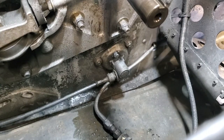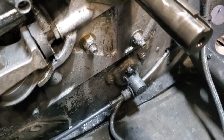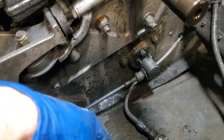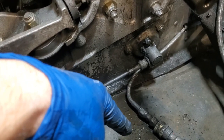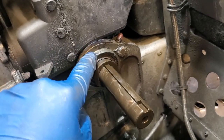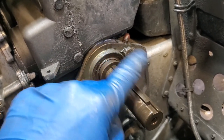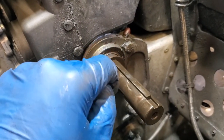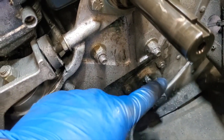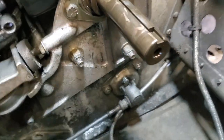All right, so there is our cover for the drive shaft down there. And this is also your speedometer cable that goes in there, and I'll show you that once I crack it open. This isn't actually anything leaking. That's just that penetrant I sprayed down there. One more thing, too. There is a grease zerk right here that you can get to for the jack shaft bearing. That's not obviously in the chain case. So pop that little red cover off and get some grease in there while you have the secondary off. It makes life a lot easier. All right, so anyways, I'm going to go down here, and there's three half-inch bolts or nuts on there, and I'll pull that cover off, and we'll take a look at what that looks like inside there. So one second.